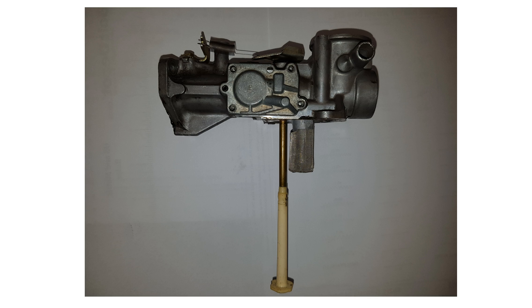To give you a better picture of where the venturi sits: when we look from the outside, if we cut this carburetor in half you would see the venturi sitting like this — a little narrowing of the tube. You would also see that the jet sits right here and it leads right down to the bottom of the fuel cup tube.